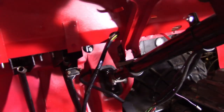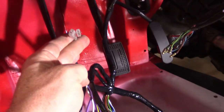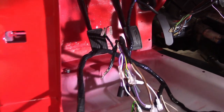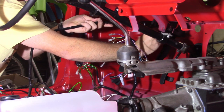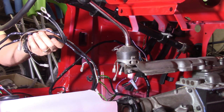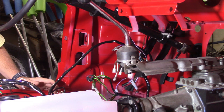These are those wires I was just talking about coming through the firewall there. I'm not going to put a grommet on anything until I'm sure that's the way I want to go. These two wires here are for the brake switches, which are right there — I'm going to plug them in because it's easy and it'll give me a little bit of support. This big long piece has eyelet connectors and heavy browns, so I know it's ignition-based. And these guys here are for the horns — all of that is going to go through that very large hole in the bottom and route towards the front of the car.